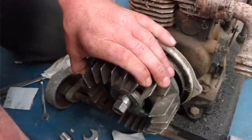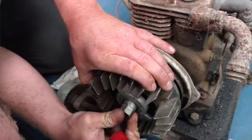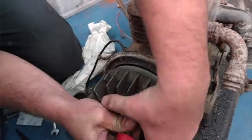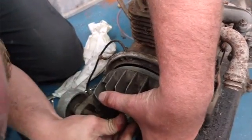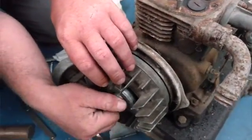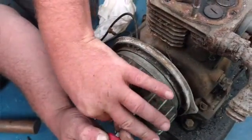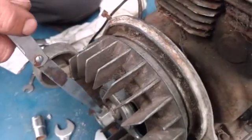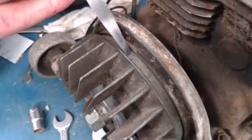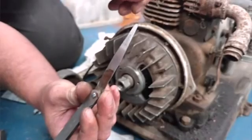It's always nice to open the points so the cam doesn't damage the lifter on the points. So we'll just pop a screwdriver in there. If you force it on you'll obviously do a bit of damage. The flywheel is on but not tight tight - it's just nipped up there to make sure the cone is seated properly. We've got a little arrow aligned with the ridge in the case.